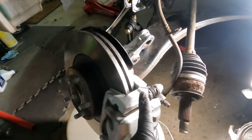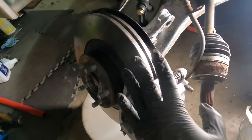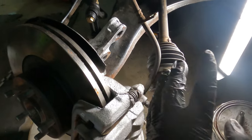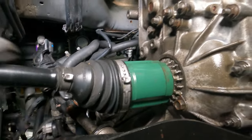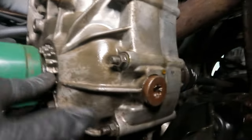We got it out — took it off the control arm, it's now leaning on the bucket. We got the axle out. Also in the meantime, unbolted the speed sensor as well. We're under the car now. In theory this should come out by popping it out with a pry bar. I put mine with tape so I don't scratch anything, as well as the bearing we're about to take out.